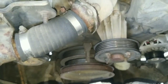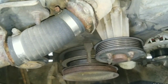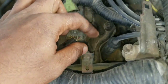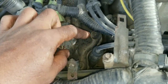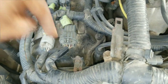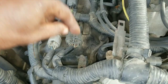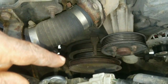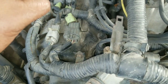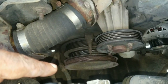In the video description there's a link on how to do so. Now to hold the pulley in position so it does not rotate when you put that wrench or socket with the breaker bar on it, you're going to need to remove the number one spark plug and its wire. You'll then need to take a rope of the appropriate size and fill that cylinder with it — the piston will have to be at bottom dead center. When you turn that pulley, the piston in the number one cylinder will move to top dead center and the rope in there will jam the piston, preventing the crankshaft from turning and restricting the pulley so you can pull that bolt off.